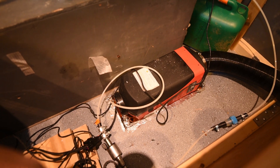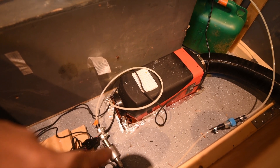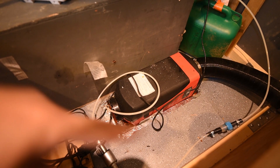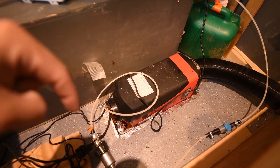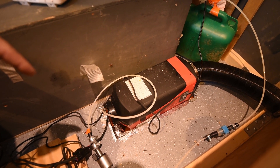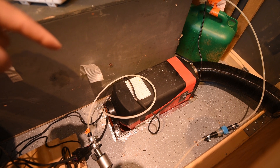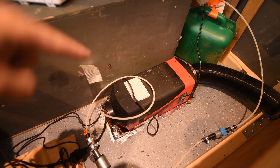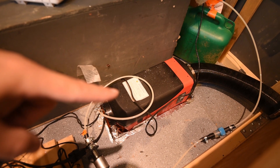That's gonna change. What I'm gonna do is put the entire fuel line under the van. So what I'm thinking is: it's gonna go from the fuel tank along the bottom of the van, fuel filter, keep going, fuel pump, keep going, and up into this diesel heater here.